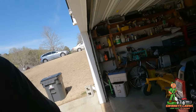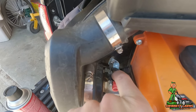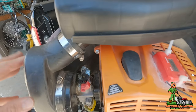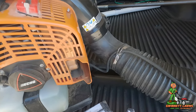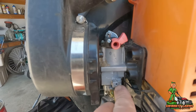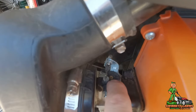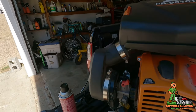I'm going to put a link to the Amazon tools down below. You're going to need two tools to do this: one, the long version of the small D fitting, and then a little tiny version of the same small D fitting. If you don't have the small one, the idle mixture — right down in that hole — you'd have to take all this off because it's in the way. The adjustment hole for the wide-open high speed is right here, and the low speed is right there.